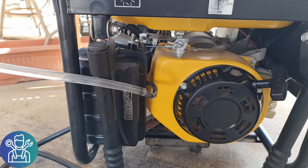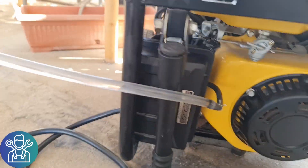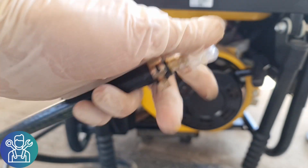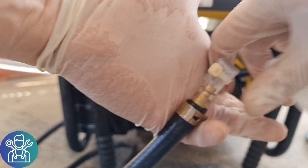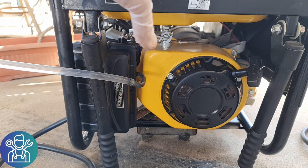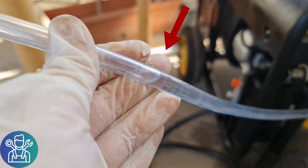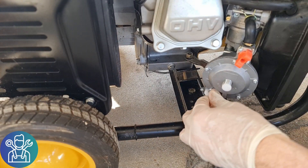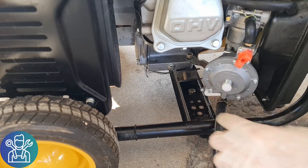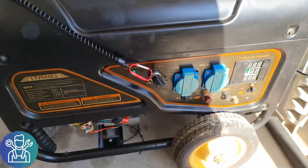Before you go, there was one last thing I wanted to check. I put the air box and air filter back. I'm still with the new carburetor running on gas. I closed the tip of the gas so nothing will go in — it's quite easy to take off, just pull it out. But I want to run the gas without filling the gas tank, because then I'd need to drain it. So I hooked up a small hose and I have gas up to here, so it's not a lot. Let's open the release valve right here at the bottom and see if it drains — and yes, it drains fine. Let's start it and see what happens.